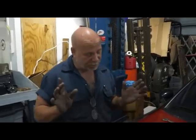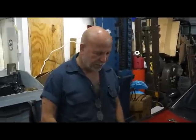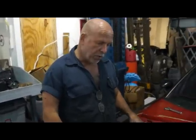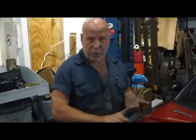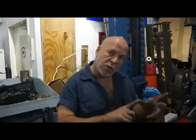Another Frankenstein, which I don't want to say, but we all have done things. One rotor with 2mm seals, one rotor with 3mm seals. I did a motor one time that turned out to be one of the best engines that's ever run. This was a true Frankenstein. I had three piece 2mm seals, one piece 2mm seals. One rotor was damaged, so I had to cut it for 3mm. So that one rotor had a 3mm seal and two 2mm seals.